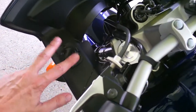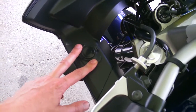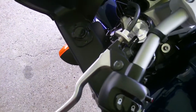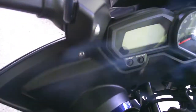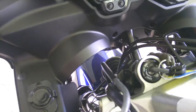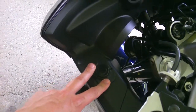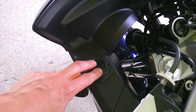The plug piece itself was about $15 or so. You also want to get a waterproof inline fuse connector, which was another $10 to $12. Then all you need is a couple of feet of wire — I used 16-gauge — and your electrical connectors. The plug instructions pretty much tell you step by step what size hole saw to use and everything.